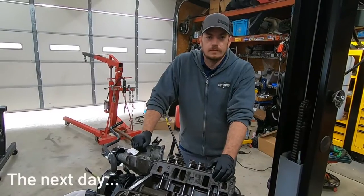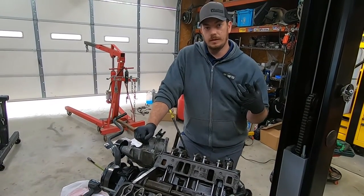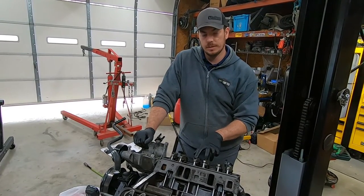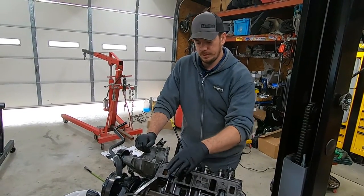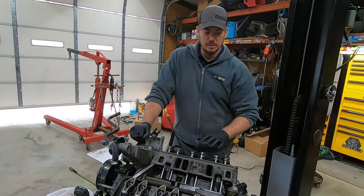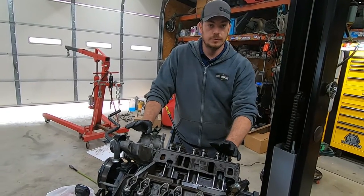All right, what's the plan for today? Okay, so plan for today. UPS has already come and dropped off our two rocker studs that we needed. Those are torqued. I went ahead and set the rockers and set the valve lash on those. The motor is currently sitting at top dead center, which is number one piston all the way up and aligned on the mark down there. So we're going to be ready to stab the distributor as soon as it is time to do so.